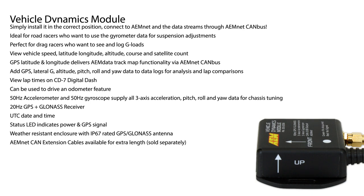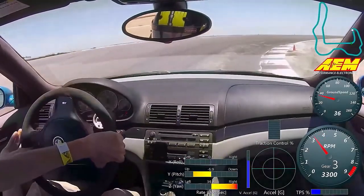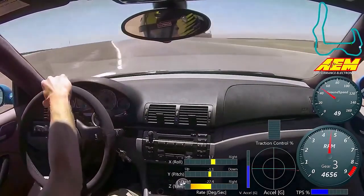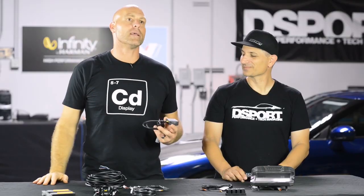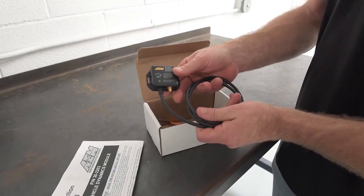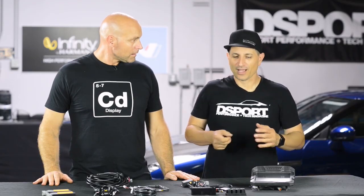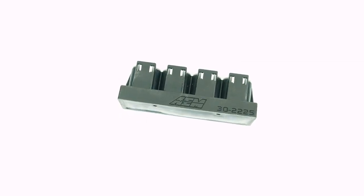It's a really cool system and so easy to install. We provide some really heavy-duty Velcro, which we recommend you use. This thing is super light. As long as you point this side to the front of the vehicle, make sure it's pointing up, and put it in the center-most part of your vehicle, you're going to get really, really accurate readings. And once you stick it on the CAN — boom — data is right there and ready for you. Everything is just across two wires. A lot of times we'll use a four-wire DTM connector so we also have power and ground there.